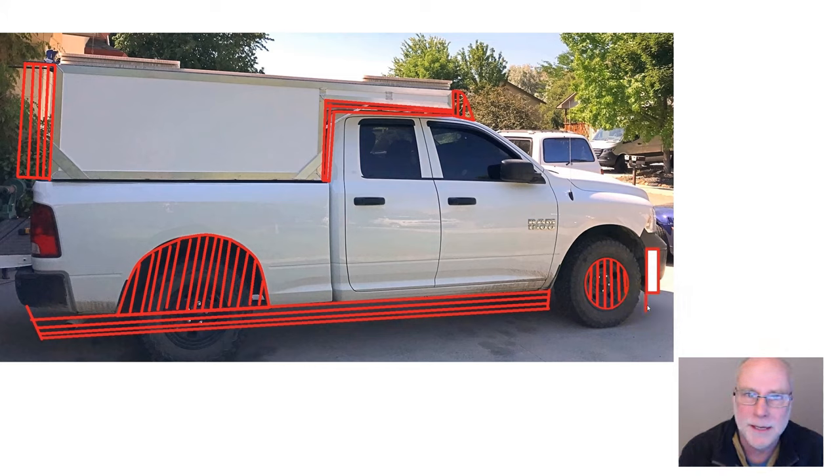A lot of those things are not what I'd recommend for cars. For a car, I'd talk about a complete undertray and wanting to get airflow under, but for a truck with such a rough underside, it might just be a lot easier to put as deep a front spoiler on as you can make it out of flexible rubber, so when it hits the road it doesn't get damaged — to stop air flowing under the truck as much as possible. To stop air flowing in from the sides, because it'll be low pressure under the truck if we've blocked the airflow, we'll put deep side skirts on and cover the rear wheel so the air can flow more easily past that wheel. We don't need to put a disc cover on — we could if we wanted — but just covering the wheel. These wheel arches are so large.